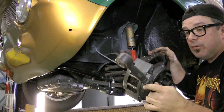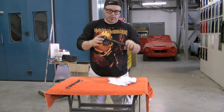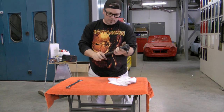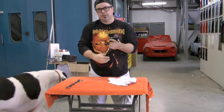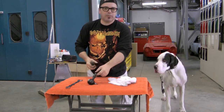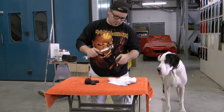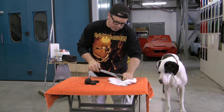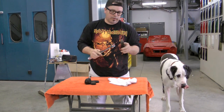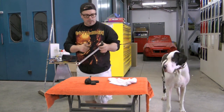Now I need to find out why it's being so resistant, so we're going to tear it down. This is the side with the ball joint - it sits on top of the upper spindle. That side seems to be threading just fine, but the problem is the side that goes towards the inner fender. The nuts on the inner and outer adjustments are 24mm, and the center nut is actually a 1 inch or 25mm.